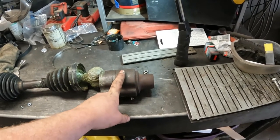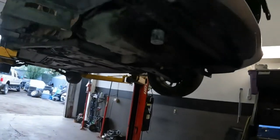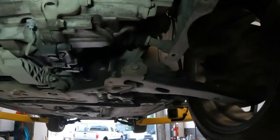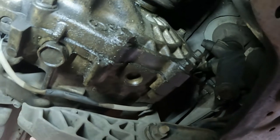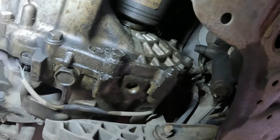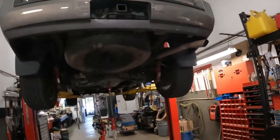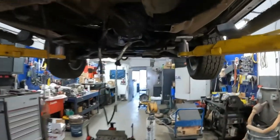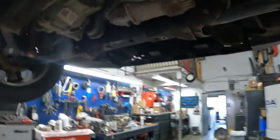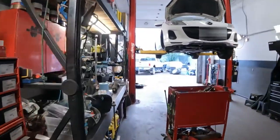There is a trick to these. This is really only a Dodge issue. If you look at front wheel drive cars, those splines go all the way into the final drive unit of the transaxle, so they're bathed in fluid all the time and they don't rust out. And for other trucks such as Chevys and Fords, they don't have that issue either, because up here it's a bolt-on flange — actually quite nice. But these Dodge guys don't have that.